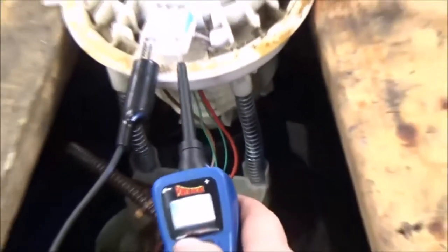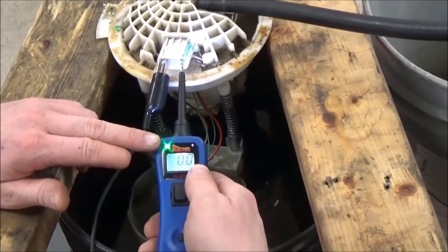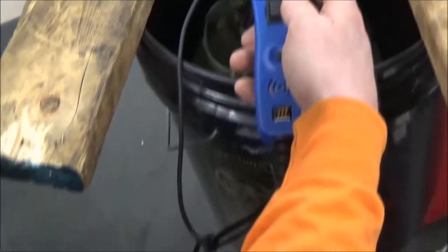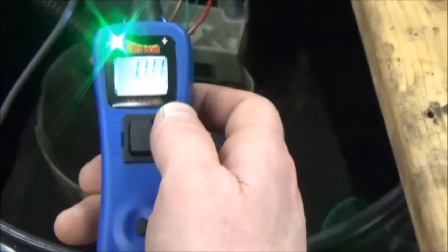Off the bench, we put it on through our hot, and we see a green light, so we know we do have ground going through. Okay, stop right there. That means that we have power going in. It's a continuity checker out that ground wire, back into the power probe, and out of the power probe we have the wire going back to a ground. So that light being lit, like CJ says, means that we have a good ground. We're always wanting to look for that. We have a complete circuit? Complete circuit, you got it.